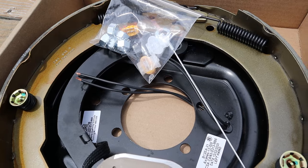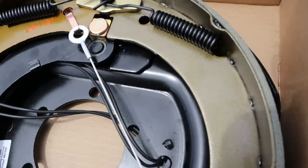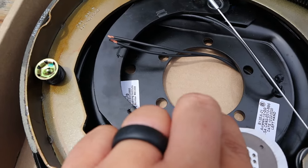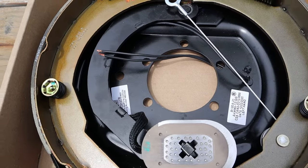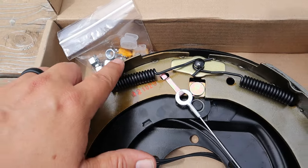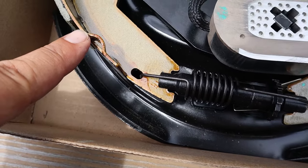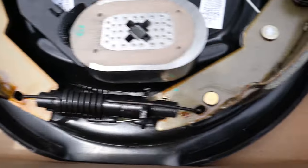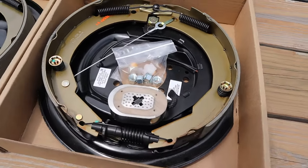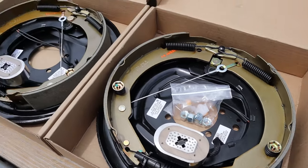There's not a positive or negative listed on here — they're dual pole, so it doesn't really matter as long as the circuit's the same. One way to tell which side is which is that it's on the sticker, but you'll also see the arm with the magnet — that arm always faces the front of the trailer. Another way to tell is that the smaller brake shoe is always the front shoe. The larger brake shoe goes to the rear. These are self-adjusting, so hopefully it's a throw-on-and-done once everything's initially adjusted.